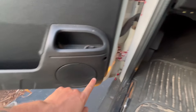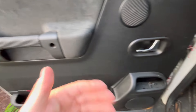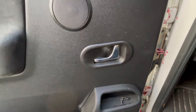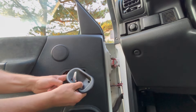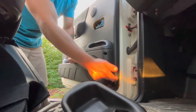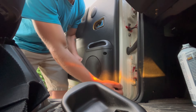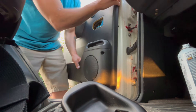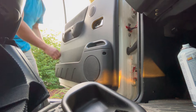There are little things that are printed - screw here, here, two down there, one right here. Take those out and it'll pop off. Use a trim pull to pull all the little nuggets that hold the panel on. I've done this a bunch so I'm just going to use my hands - it goes all the way around just like so.